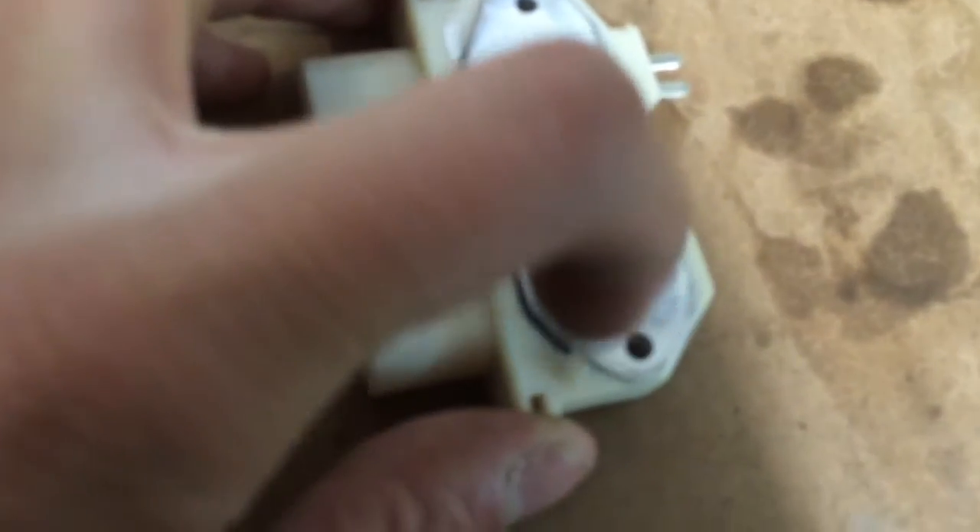Emptying the contents. Take a nice amount and spread it around with your fingertip — just like as if you were doing your brake pads. Nothing too fancy. Just on the backing plate only. You don't have to put it on the connectors or anything of that nature. Just on the backing plate. They only give you enough — not even a teaspoon of this stuff.